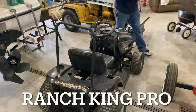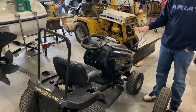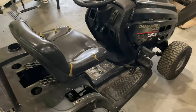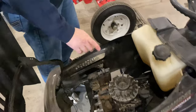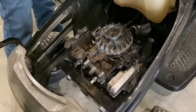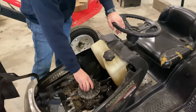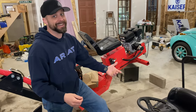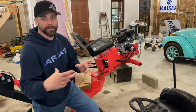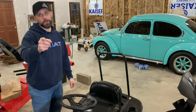This one was just a weekend project. I got this little lawn tractor for free because the engine was blown — the guy was going to throw it away. I chopped it up quite a bit, did a pulley swap, and put in a 5 horsepower push mower engine. With the pulley swap it'll do about six or seven miles an hour. All you do is grab your cordless DeWalt drill and it fires right up. If I want it to go faster, I need to get a bigger pulley under there and run the pulley system above the frame to have that space.